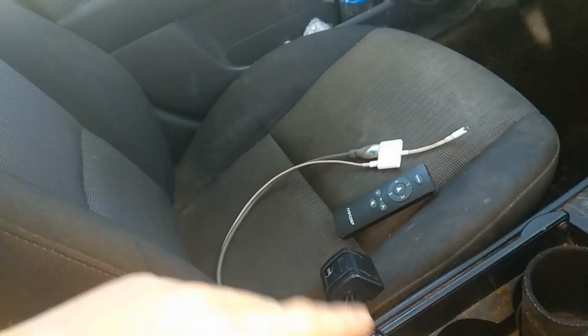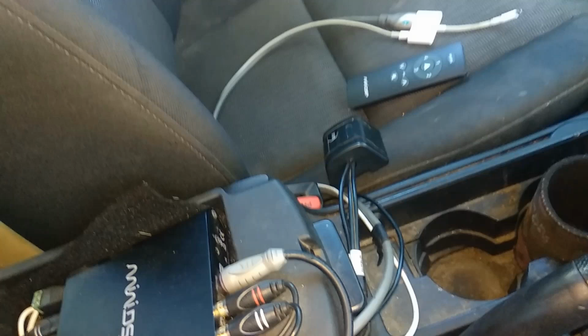So I skip the analog to digital converter and any noise interference that would be amplified before that, and it should be the cleanest possible signal. So that's anyway the theory behind that, and that's why it goes HDMI to optical to, yeah, it's a big mess, but it works quite well.